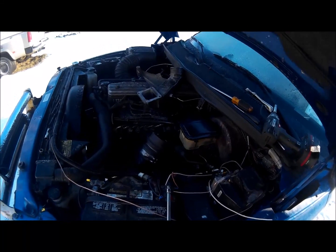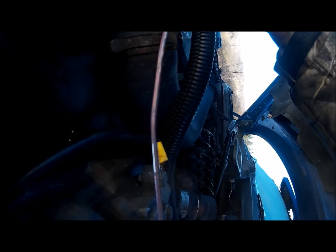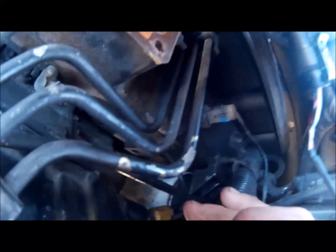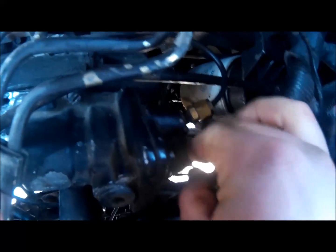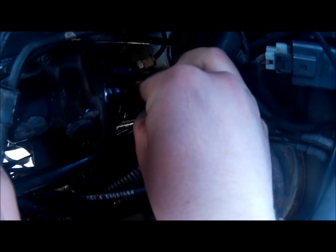First thing we've got to do is remove that back cover. I'll grab a little allen wrench here because the bolt that Dodge uses has little holes in it so you can jam something in there to turn it. Mine's only finger tight — when you have your AFC off to remove that tamper-proof lock bolt, you might want to leave it out or put it back in only hand tight, just so it's easier when you remove it next time. Give me a moment to get this protective cover off.